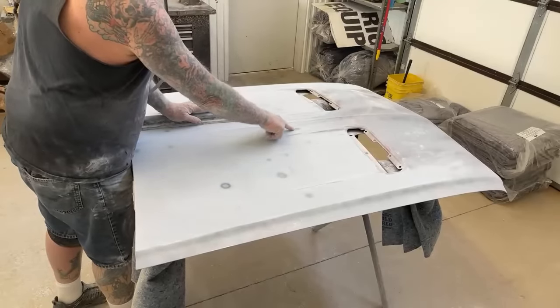Let me tell you what I had to do to this hood to make it work. On this side over here, I literally had to take almost three-sixteenths of an inch out of the hood and then roll that lip back over. I don't think I had to do anything to this other side - this side lined up great. But on that side, this is really common on aftermarket panels: to make this line up right with the body lines on both sides, I literally had to remove material off of that hood.